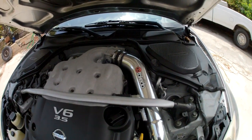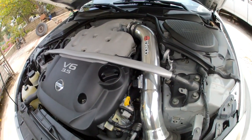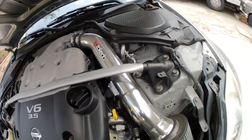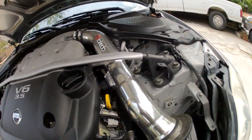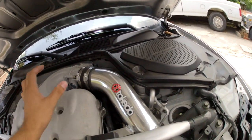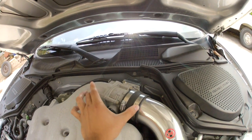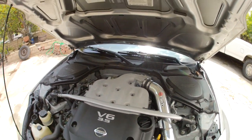The isothermal upgrade also addresses the coolant line, because Nissan decided it was a smart idea to heat up the throttle body with this coolant line right here. Pretty much Nissan designed it so hot coolant heats this up to prevent it from freezing in colder temperatures for people that live in colder parts of the country or world.